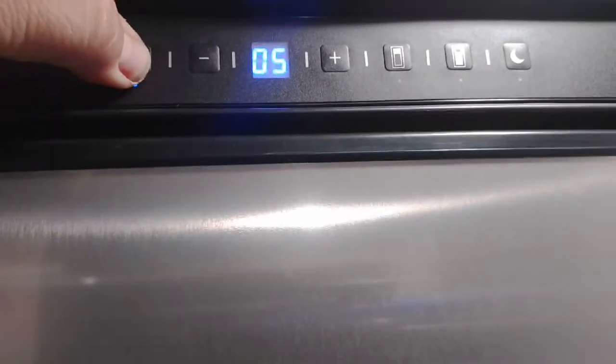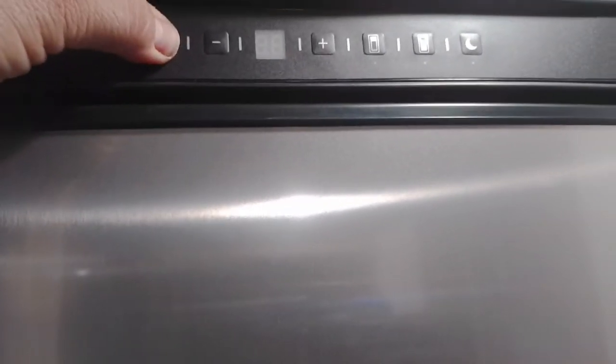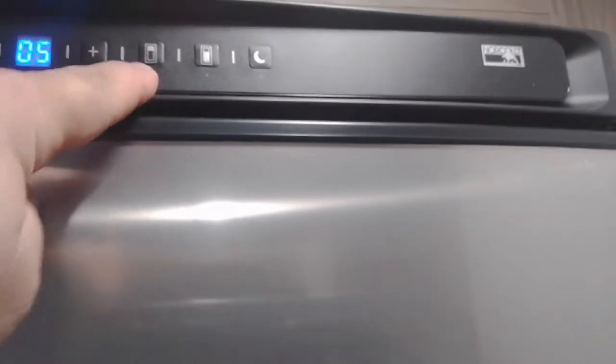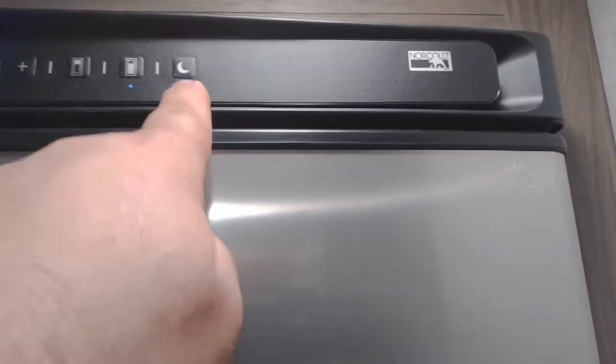Fan and microwave are here. Behind me, this has a 12-volt fridge. Power button on this — when you push and hold it for about five seconds, it'll shut off. Same thing to turn it back on: push and hold it and it comes on. Temperature down, temperature up — this is your freezer temp, and if you push this button it switches to the refrigerator. And then this is the night mode — all that does is make the compressor not run as often so it doesn't kill your batteries quickly.